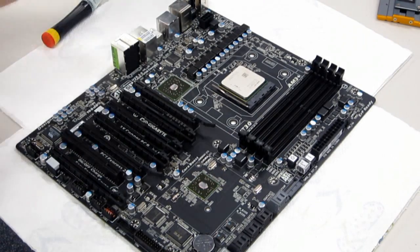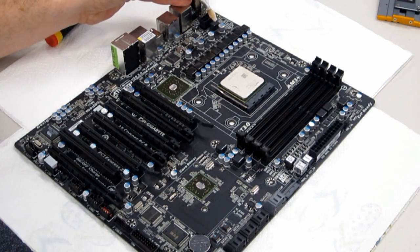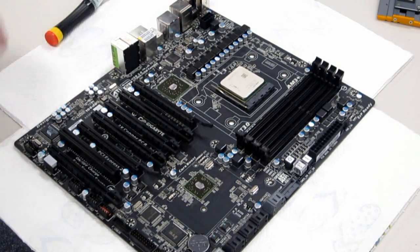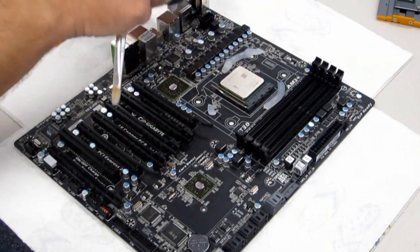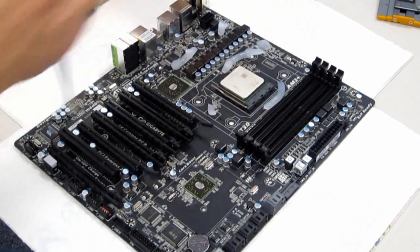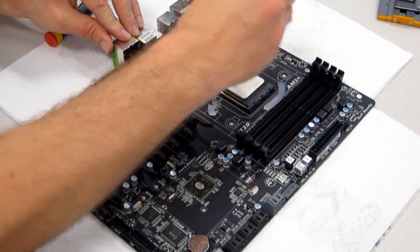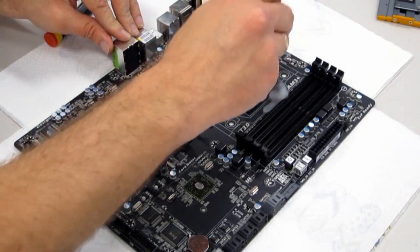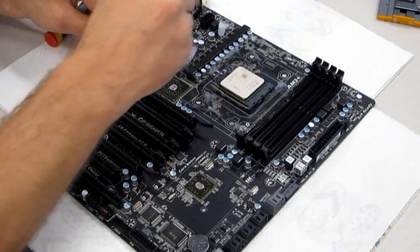We need to insulate right around the socket area thoroughly so we don't end up with any condensation issues causing a short, which could cut down our overclocking session or potentially even kill the components. I'll put some thermal grease in and around the socket. Most of you who have seen my articles before would have seen me do this process — I simply use a paintbrush which makes for easy application around the socket, coating all of these little circuits nice and well.